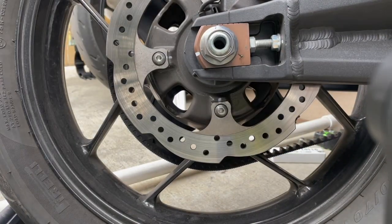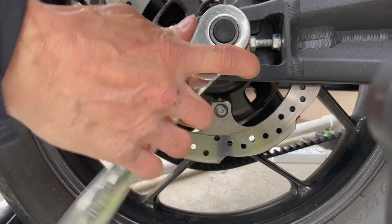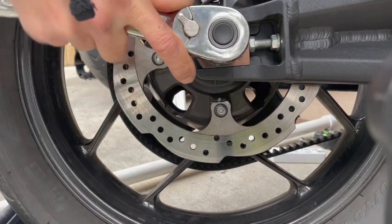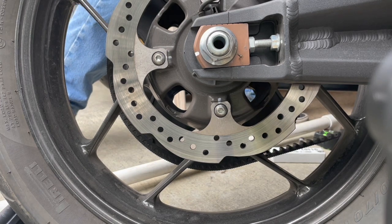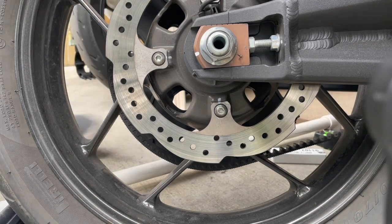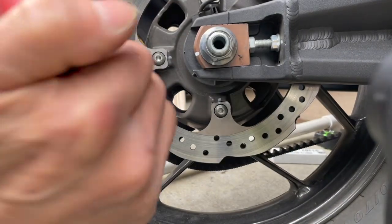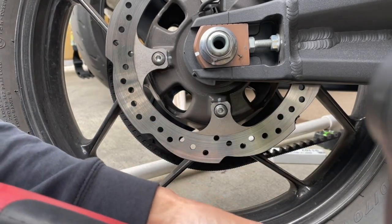That's good - I'm good with my tension now. I just need to tighten this back up with the socket first. There's actually a torque spec for this: it should be 75 foot-pounds. 75 foot-pounds is not that much - it's actually less than car lug nuts, which are usually around 80 foot-pounds on a regular passenger car. So on the bike it's not as much.